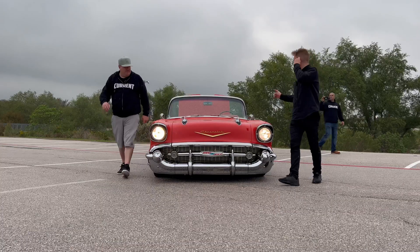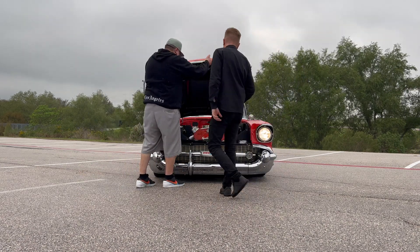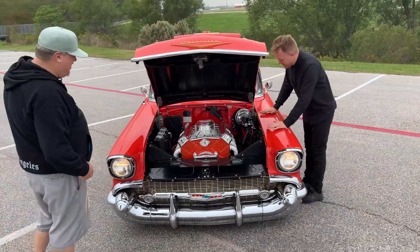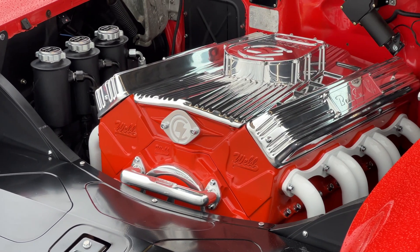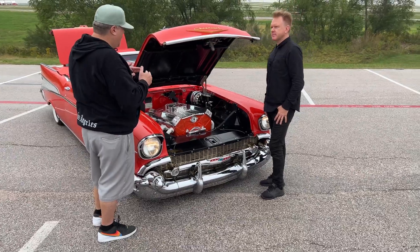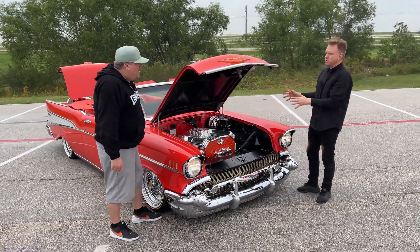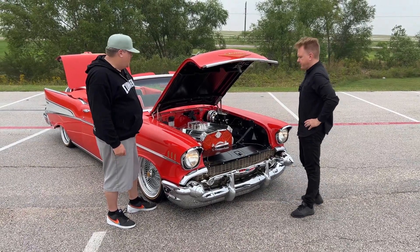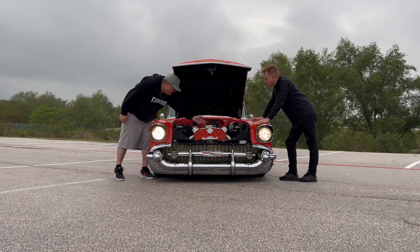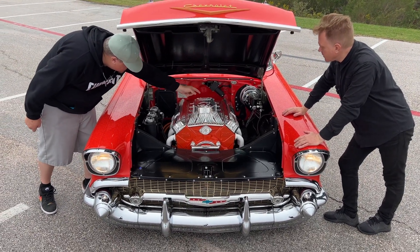Let's see what's in the front. That's quite a surprise because there is a V8 underneath! It's an electric V8 — we call it a V0. There are no cylinders — this is a cast aluminum battery box. We have a friend named Chris Webb of Webb Motorworks up in Canada who hand-makes these molds, has them cast in aluminum, then sends them to us and we weld them up, paint them, polish them, and put components inside. This is filled with batteries from front to about the rear two-thirds. Electronic components — the inverter and battery management system — are in the back.